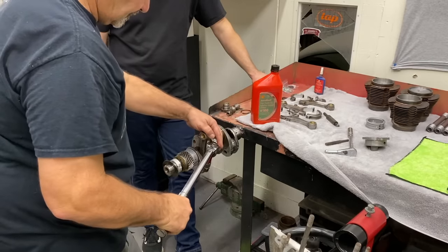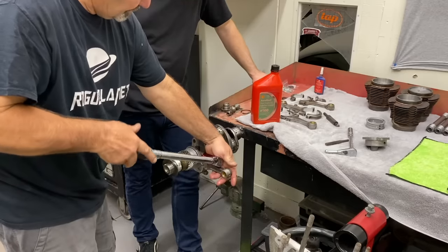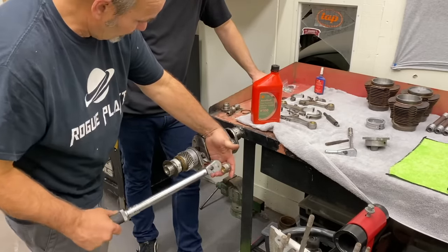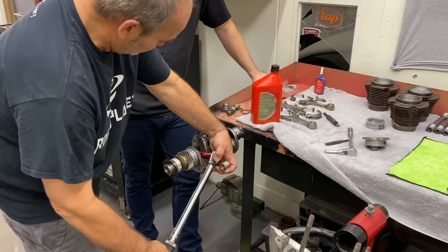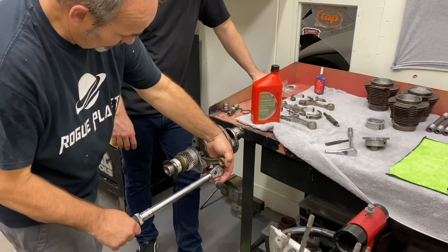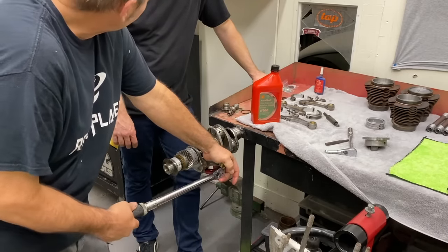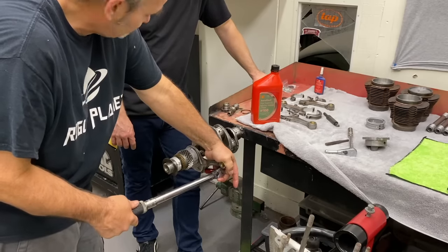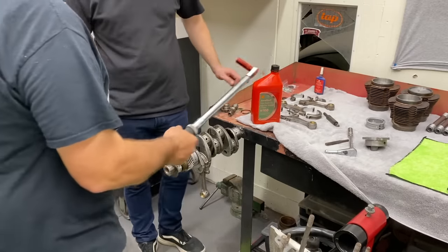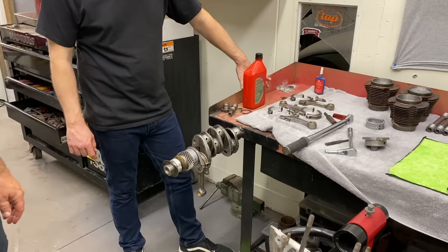You torque them. I tighten it a little bit over here, and I come over here and tighten it a little bit, and then I go back over here for my torque. I go back and forth a couple times because the torque's pretty high on these. Click, that's torque. We're going for 35? It's 27 to 38 is the recommended torque value. I picked 35, in the middle. It's an older bolt. We want our rod to spin like that when we're done. Nice. Okay, you try it.